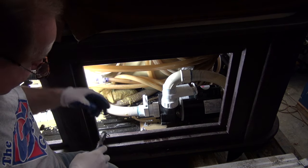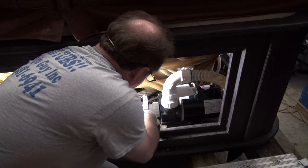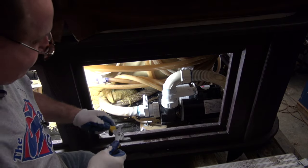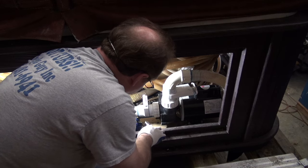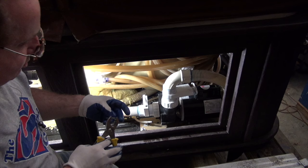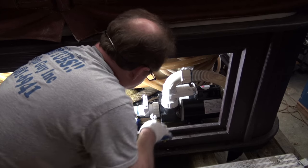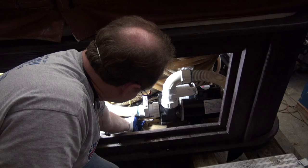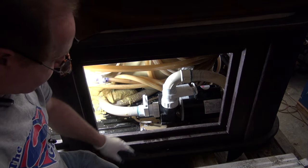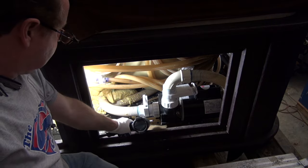The only thing I have left is hooking up this bleeder, and of course making sure there are no leaks and that it works. I put the wiring back in the back, mounted the pump, and got it all in place. I'm going to warm this pipe — the bleeder — just a little bit because it's not being very flexible. This particular brand does use a clamp; most of them do not. But I'm going to use the clamp because it's there. It's generally suction and water weight, so it's generally not an issue.